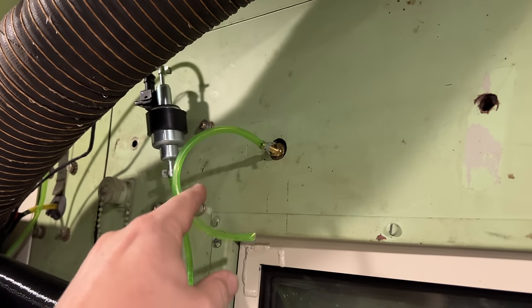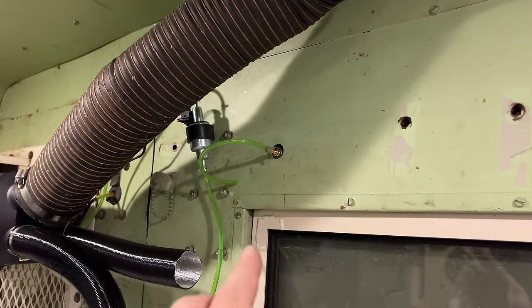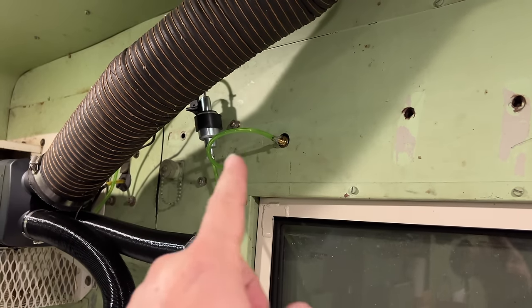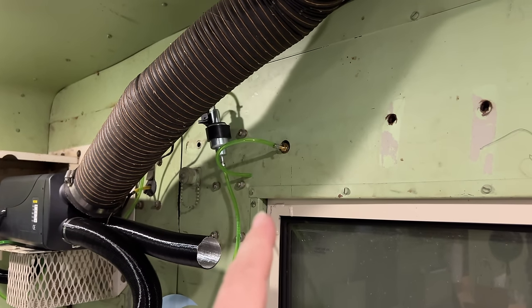Right now I've run into a little issue where I can't get any diesel to come out. I might need more diesel in my tank — I might be below where the standpipe picks up fuel, because you don't want the heater to use all the fuel so you can't start your truck. There's a standpipe that only lets you draw so much to the heater, and then it stops. I'll need to fill up the tank before I can test that. For now I just have a longer hose going down to the diesel tank that came with the unit, until I can troubleshoot that or fill up with more diesel.